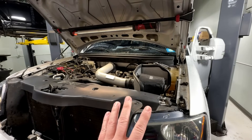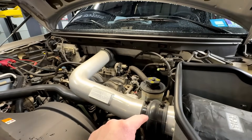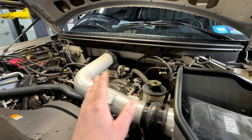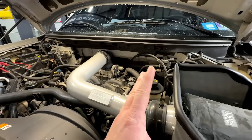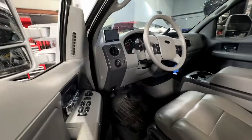One thing you'll notice is that tick is constantly there - almost sounds like either an exhaust manifold tick or a valve train tick. It's there from cold and never really goes away, whereas an exhaust manifold tick, once it warms up and expands a little bit, will start to go away. I'll start it up, let you listen, pull a plug or two, and see what's going on.